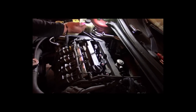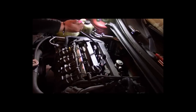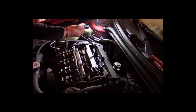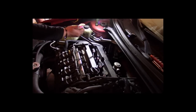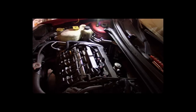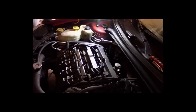And then what we're going to do is I'm going to turn the engine over. And guys, when we get to the compression stroke, she's going to feel some air. There's definitely, do you feel it? Okay. Yeah, you can hear it. Okay. So you can let go. And then we're going to connect up our air to it. I'm expecting there's going to be no compression here and the engine won't even rotate.